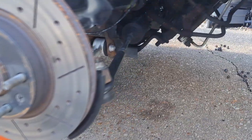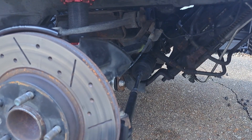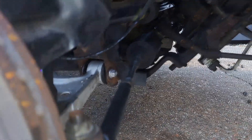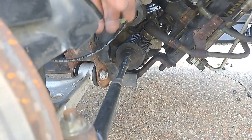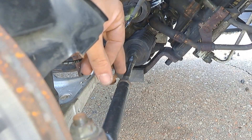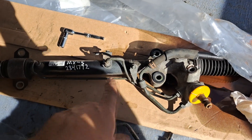I've been having a clonking from my steering rack. I tried to play around with the adjustment that you saw in a previous video, but that didn't really work — it either locked up the steering with no self-centering, or if I loosened it off the clonking came back. I've got a Wales trip event quite soon with MX-5 guys, so I've bought a secondhand rack off eBay from a 2014 car with supposedly around 26,000 miles, so hopefully it's just going to be a bolt-on job.